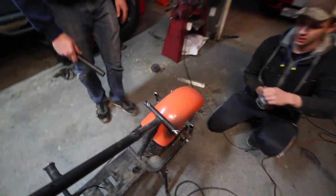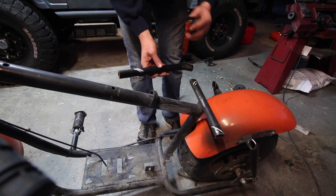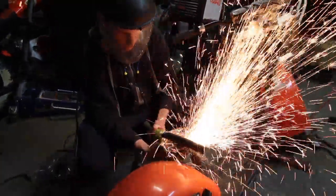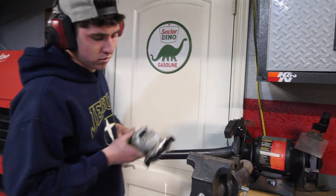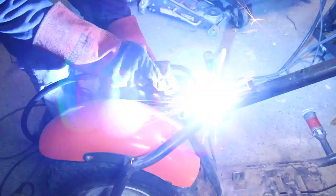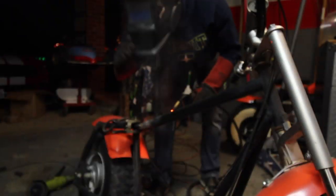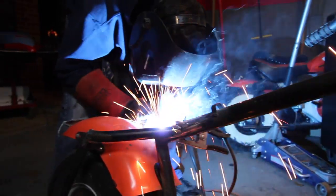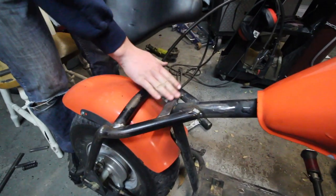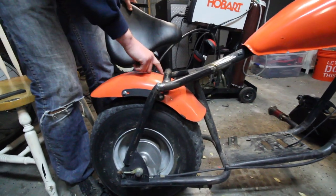I cleaned up all the old remnants and old metal work welds so it's all smooth. This is basically notched. This is actually some scrap metal we had — we bent all the bends the same as on the kiddie pool go-kart, so we used two identical bends. They're actually gonna work really nice. We really want to get the seat as low as possible. We finished up all the framework and it looks really good — we gusseted all of it, put this bar in, and it looks pretty stock. We used a piece of eighth-inch steel to keep the gap underneath consistent throughout.